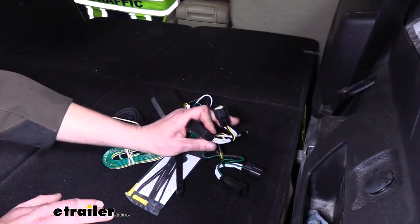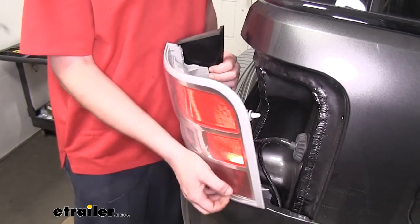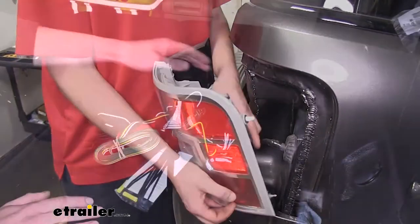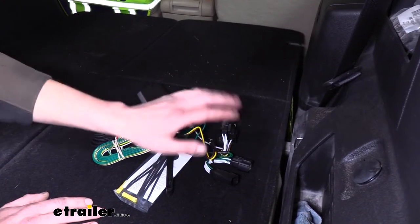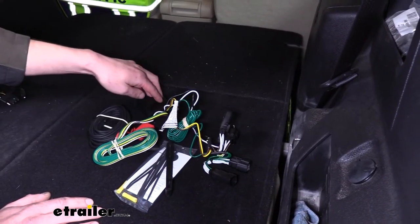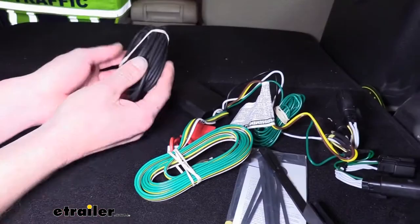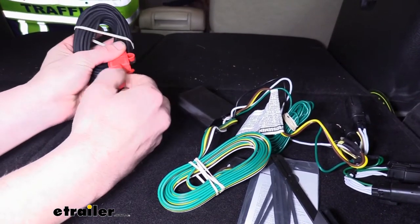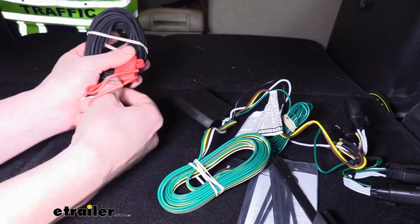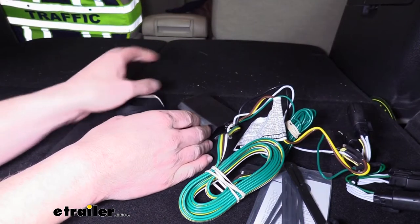On the Curt setup, these connectors are just for monitoring the signals. They plug in between your tail light assemblies just like the Tekonsha, but the module will just monitor to see if you're sending any turn, tail, or stop signals out to the lights, and then it picks that up and generates its own signal and sends it to the four-pole connector. It's able to do that using the standalone power source that this module has, so you'll hook your module to your battery using the included fuse harness and then run that power wire to the back to connect to your module.